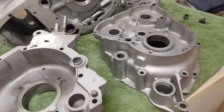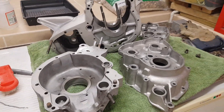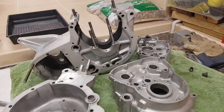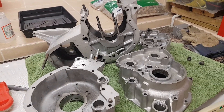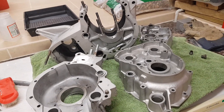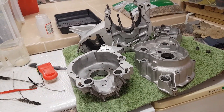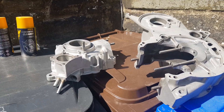When you start the engine the grit will just get carried around by the oil and it can wreck the engine straight away. Next up I'm going to put compressed air on all the oilways, and then I might get the jet washer out and give them a good jet wash through the oilways as well. I'm just a bit worried that the jet washer can throw up a bit of dust and grit if you're not careful. Anyway, phase one is done — I'll leave them a bit, put the compressed air on, and see how clean they are.